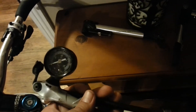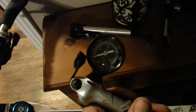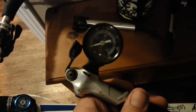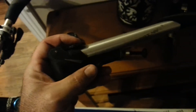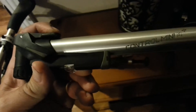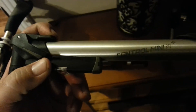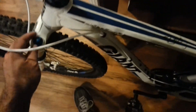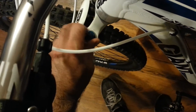If you don't have one of these, don't try adjusting your fork pressure — you can lose all your air. And if you're trying to get your fork pumped up with a regular bike tire pump, you're just not going to get it. There are a few people who have actually tried adjusting without a shock pump and you can ruin your fork that way.